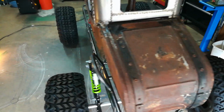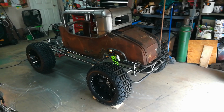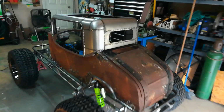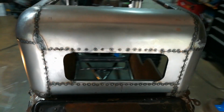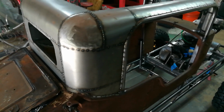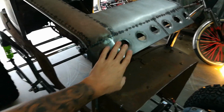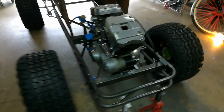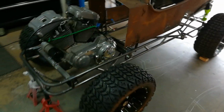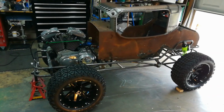And then I've got a couple of other round objects that I use here in the shop for stuff like that. And that's it. The rest, it's all the same way you would do any custom sheet metal fabrication. I use all TIG tacks. I know most people use MIG for this type of work. And same thing with these holes. I don't have a dimple die set. Those were all done by hand too. So if people tell you you need an English wheel or a power hammer or a power planishing hammer, you don't.